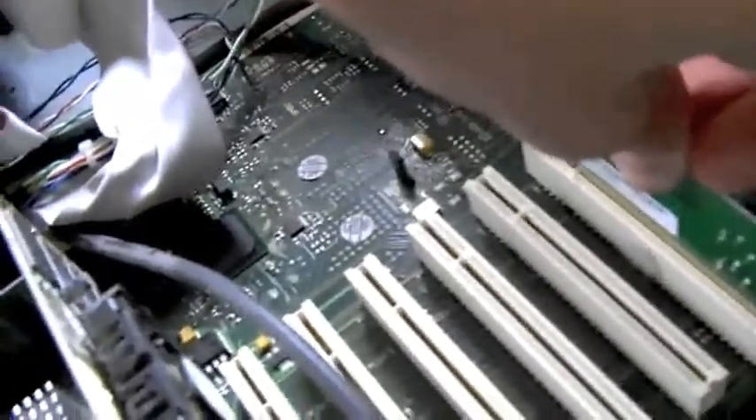Now you just want to very gently push. Just push. And you'll hear a little click. Now you need to move that so that it's ready to take the screw which you've taken out. Just putting that on the end of the screwdriver, and now all you need to do is just pop it in that hole and start screwing. Just finger tight in case you want to take it out again at a later date. So that's the card installed.